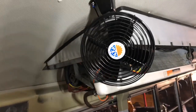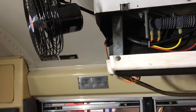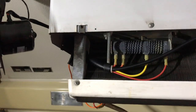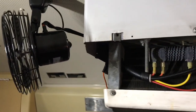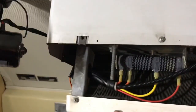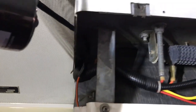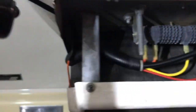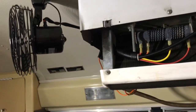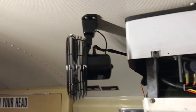This is the experiment I was talking about — a cheap little experiment. Drivers are complaining they're not getting enough cool air. They've got three evaporators back here, which is somewhat cool, but the driver is getting nothing. This AC unit is roughly six or seven feet away from the driver. I'm mounting an auxiliary fan on the outside of the evaporator box, running the wires through the case to keep it clean. This fan will draw air from the two side vents and the front vent, pushing it toward the driver. If we can drop that heat by five to ten degrees, I'll be happy with that.